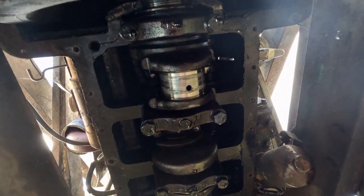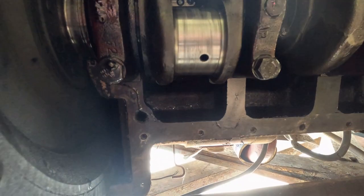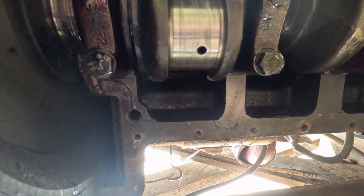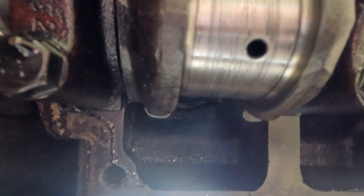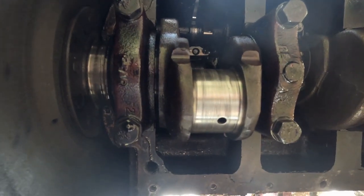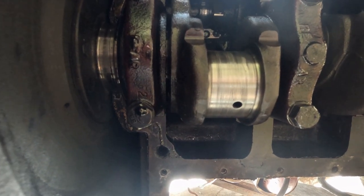Alright, I'll get polishing on this and see how it goes. It's a lot of work trying to scrub bits of bearing material off the journal, but it's not looking too bad. There's a little bit I've still got to get off, but I'm actually - I wouldn't say happy, but it's turning out better than I thought it was going to. We'll put it that way.